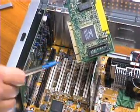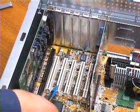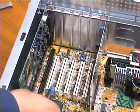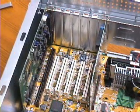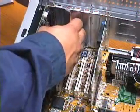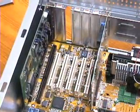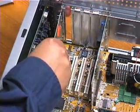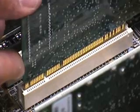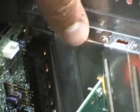So this PCI connector from the network card has to go in one of the motherboard PCI buses. I will choose the bus that gives me some space in between the other installed cards. First, I remove the slot piece of metal next to the PCI slot for the network card. Make sure to match the notch position of the card with the PCI slot. Tightening the screw sometimes causes the card to move in the slot.